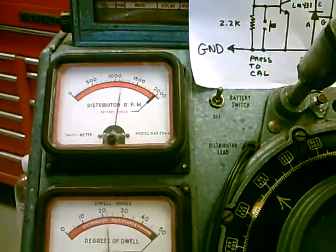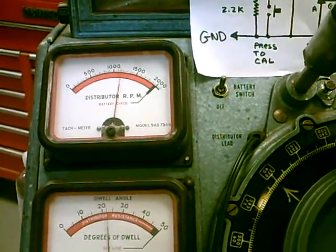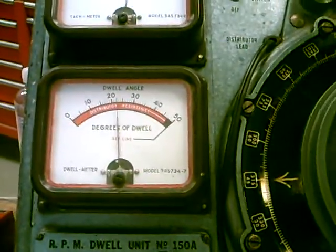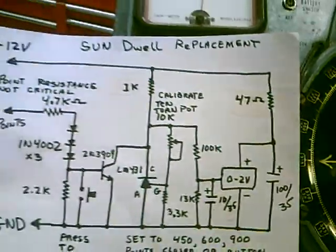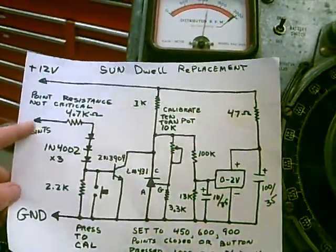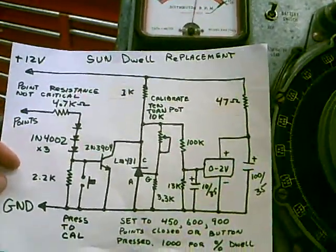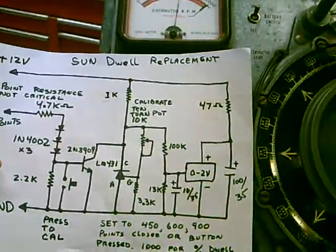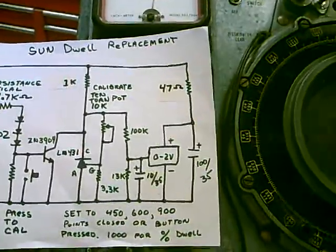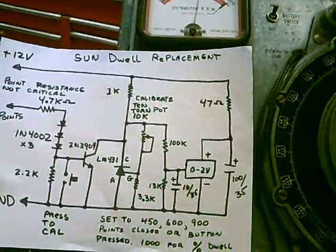The tachometers — if that doesn't work, you can buy digital tachometers for only about $15. We use them on the other machine and it works real nice. So I have this cal box. We calibrated it up just the way the factory said, and we're getting different numbers. So here's our schematic for the dwell meter. Points come in here, this transistor shorts out the voltage reference, we have a capacitor smoothing circuit, and then it goes into a zero-to-two volt meter. It's fairly simple.